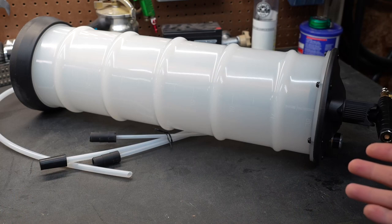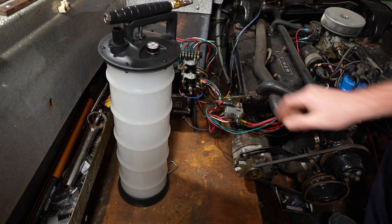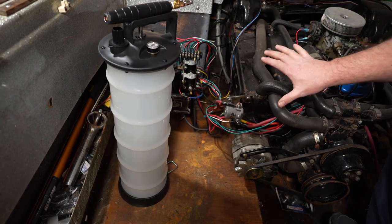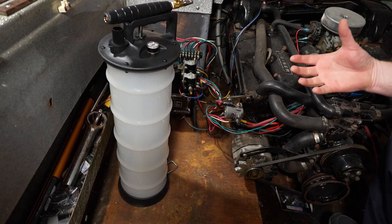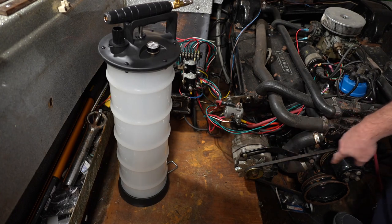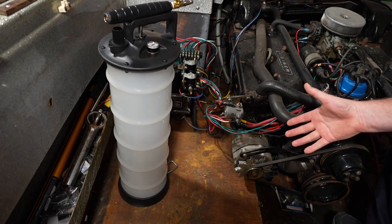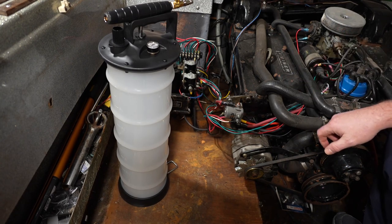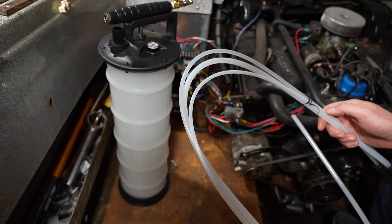But I suppose the question in everybody's mind is how well does it work? We're in the back of my boat, and this is a perfect example of where one of these pumps becomes really handy. In the back of my boat is this Merc Cruiser — it's a Ford 302 — but there is no oil plug on the bottom of the oil pan. This is by design because the bottom of the engine sits inside a pit and you just wouldn't be able to get to it. So standard procedure on changing the oil on one of these types of engines is to actually pull the oil out through the dipstick. We're going to pick the thinnest tube possible and feed that tube through the very same tube that the dipstick is in until it hits the bottom of the oil pan.